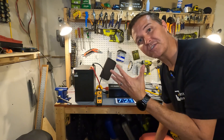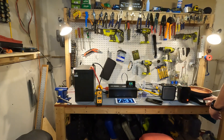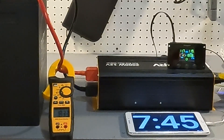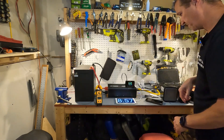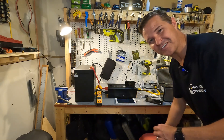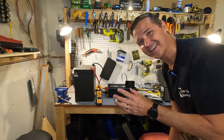Now I'm going to turn on everything and boost it up to 2000 watts to see if it can handle it for five more minutes. Turning on the 500-watt heater and setting the New Wave to 1300 watts — the display is showing 1700, 1800, 1830, 1845. I'm only getting up to about 1800 watts, so I'm going to swap in a gridler which is 1100 watts. As soon as I turned that gridler on we were at about 2600 watts and it shut off. So let me go ahead and restart everything and try to get right at 2000 watts.